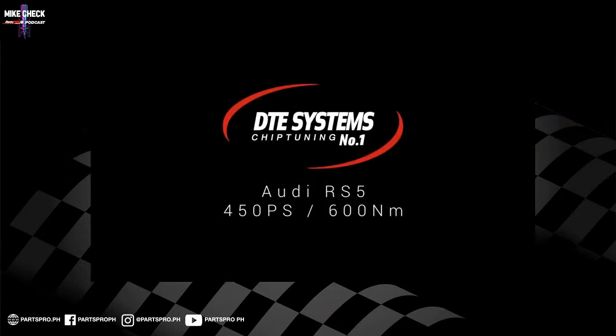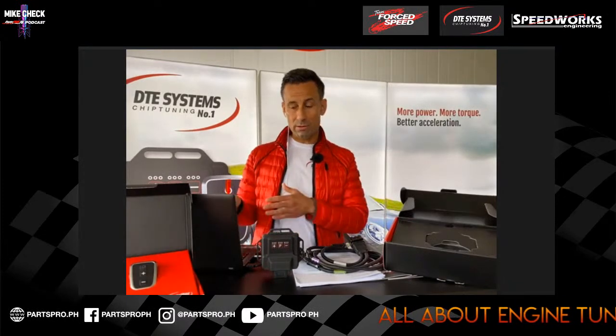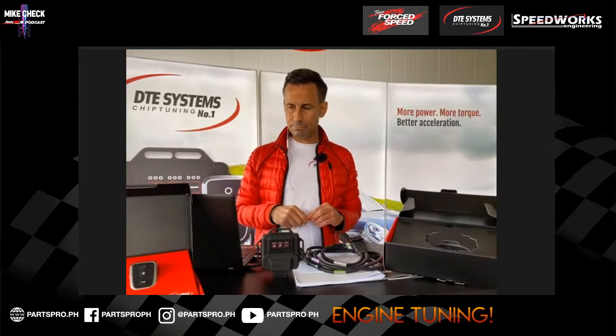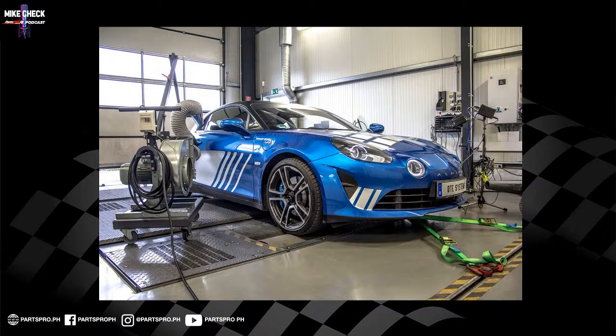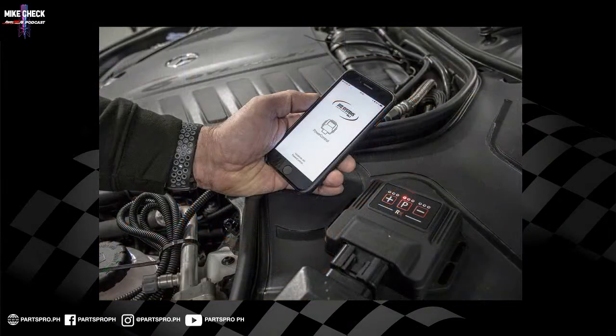So normally the files on the power control are developed based on standard, on stock engines. That's an important point. And the second thing is they're developed for diesel and gas or petrol engines. For methanol, I think we should go more to ECU mapping. Reading his question, I think the way he applied methanol was quite like what Mr. Dominic Cuesta did for my STI before, which Jeff knows also. We put a water methanol spray just to be able to cool the air as it comes into the throttle body, to make it more dense. So basically, for Power Control X, for that kind of extensive modifications, it's not exactly the product.